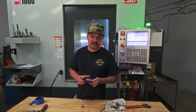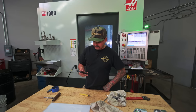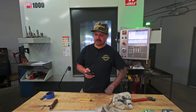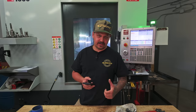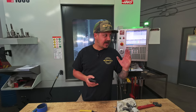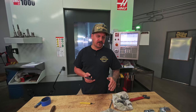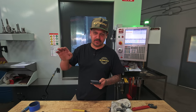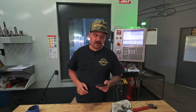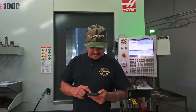Why don't we use diesel platforms? We've shown my diesel before, but those platforms are a little heavy and not really the truck you want to be jumping and going through the desert in big whoops. The front of those trucks is really heavy so you'd have to move the motor and trans back a lot. I like gas engines and naturally aspirated engines — you have a built motor with throttle response right when you hit it. If you're coming up on a hole and want to chop the throttle to pop the front end, you can't really do that with a diesel. Emissions? The customer has to take care of that on their own.